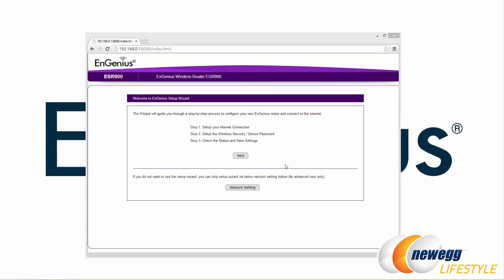All right, guys, so here's a quick look at the GUI. Some things you want to keep in mind when you're getting connected is that it actually propagates its own DNS name, so anything you go to will be forced to forward to 192.168.0.1 port 8080, which is what you're going to need to administer the router. Something to keep in mind in case you're worried about not knowing which IP address to put in. That is, of course, if you set up your systems to use the default DNS, which is whatever the router would be.